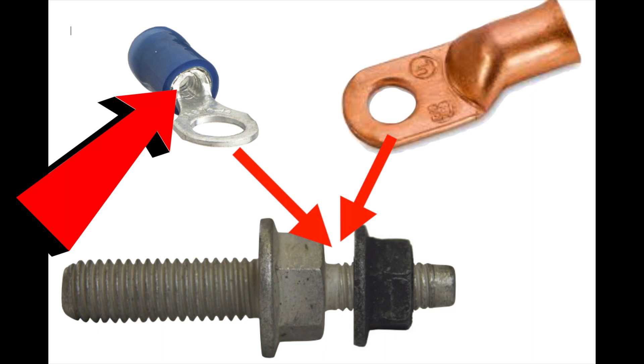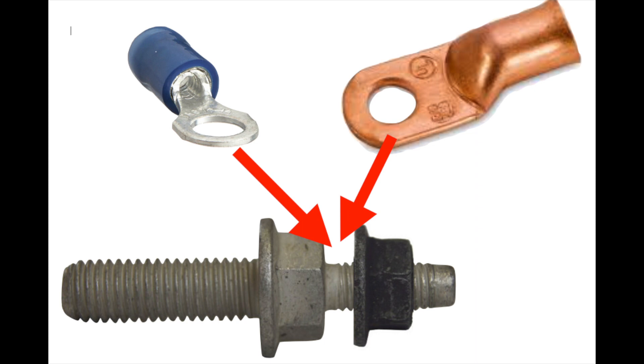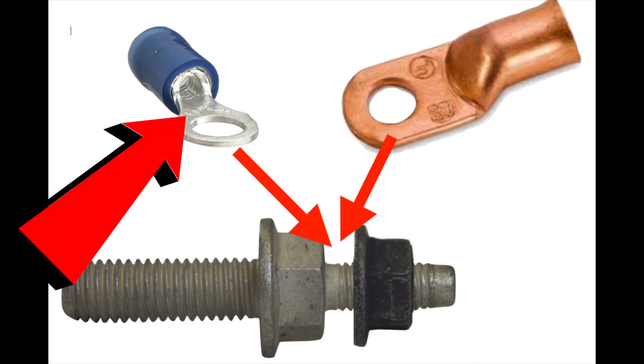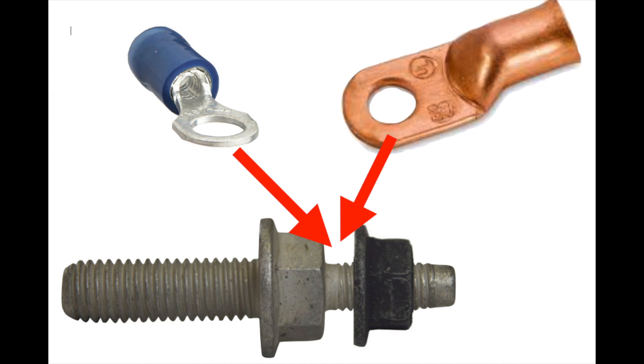But this clip here was broke, so the wire to that was tied in to the battery cable. This clip right here was not big enough, so somebody tried to squeeze it in. They did not crimp it, they did not use electrical tape to hold it in — they didn't do anything. So the battery ground was just hanging off of there, and this ground wire was just kind of wrapped around it and also hanging loose. When the car vibrated it was getting a terrible ground and both of those wires were heating up. While my plan was to drop the starter out and check the solenoid, the first bolt I took off the starter was this one — I just took the ground wire nut off and I could see my problem. You could also smell the problem: the wires were melting.